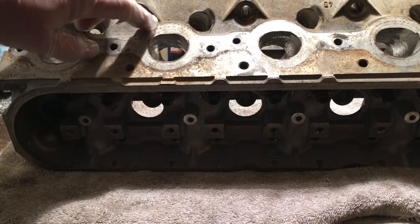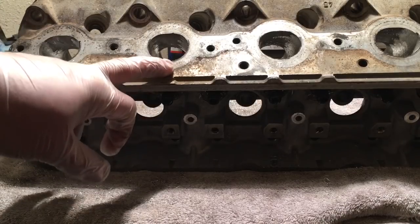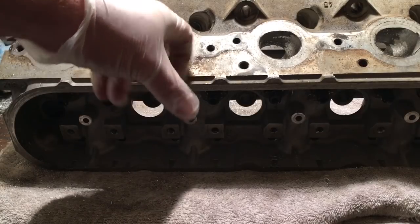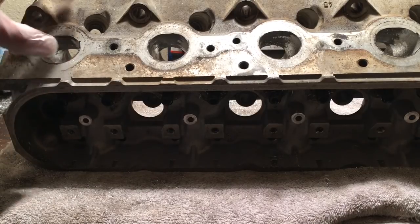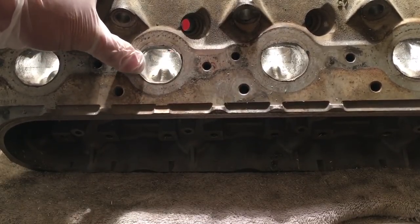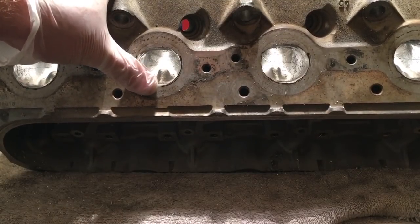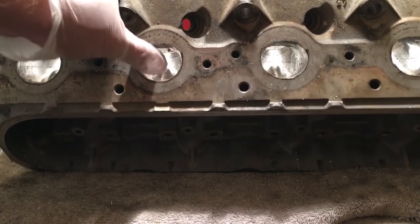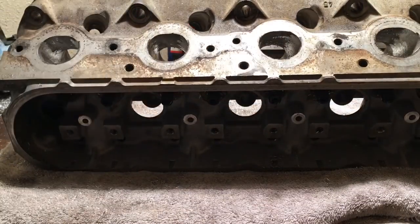I've removed nothing from the floor, but when I raise the roof I literally blend it all the way back to the bowl. You see a lot of people, when they're trying to work these heads, will funnel port the outer edge kind of at an angle to get to a bigger diameter — but they're not actually creating a bigger port. They're just opening the exit hole.